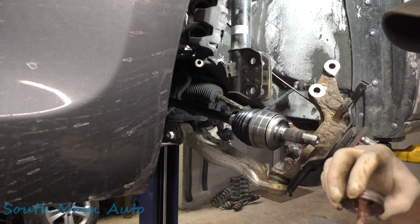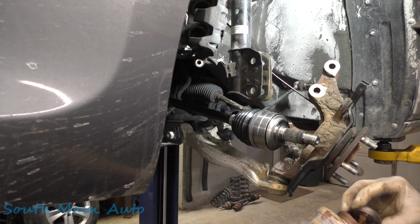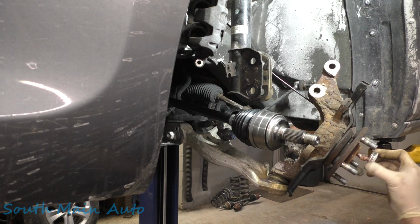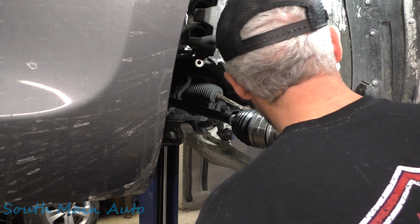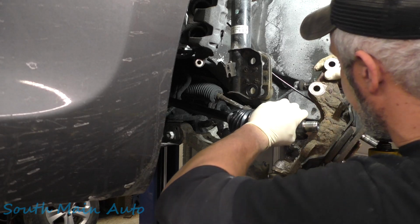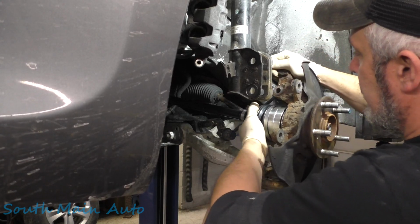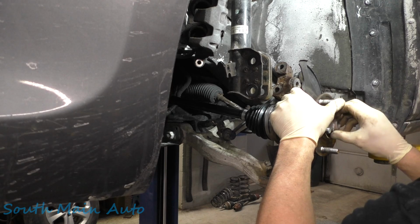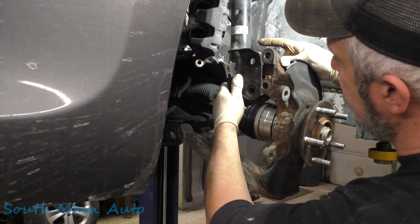We're gonna take a little anti-seize. We're gonna put it inside the splines of our hub here. These don't have a tendency to seize, but we like to make sure with some anti-seize paste. Make sure that there's not a lot of junk stuck to your magnet. And if there isn't, we will line this up very gingerly. Slip that baby in. Slip on the axle nut. Get a couple threads. Bring it around. Now watch your boot. Don't rip your boot now.